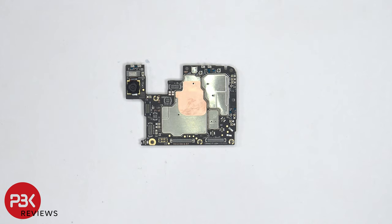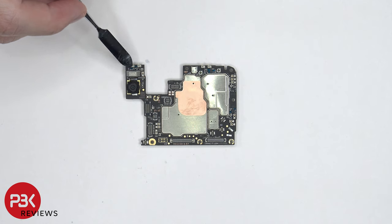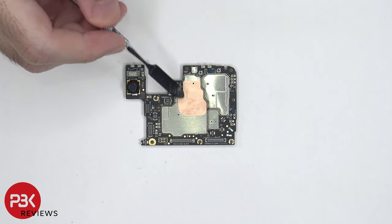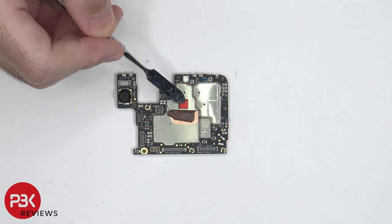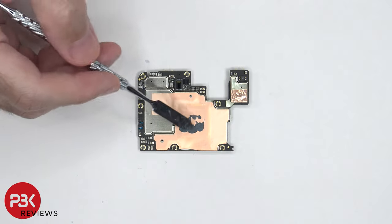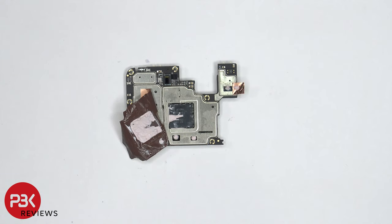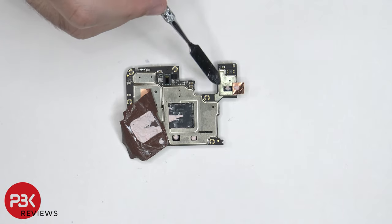On the main board, there's a secondary microphone on top underneath the shield. The other camera is located over here and the connector can be disconnected by just popping it off. There's some copper tape on top of this shield, and once peeled back we can see a red thermal pad underneath. On the other side of the motherboard, there's a proximity sensor, more copper tape on the back shields, thermal paste, and an IR blaster on the top corner. Peeling back the copper tape reveals thermal paste on top of the RAM, processor, and other chips.